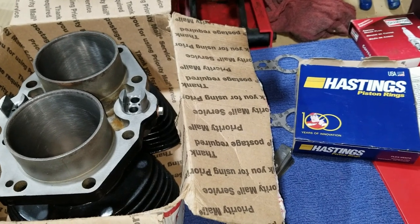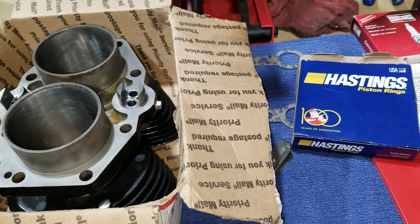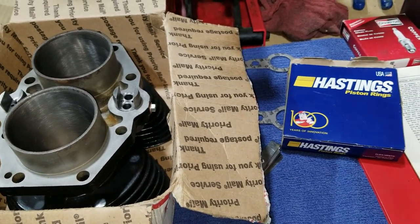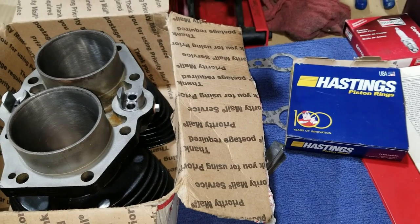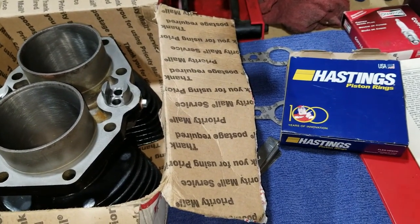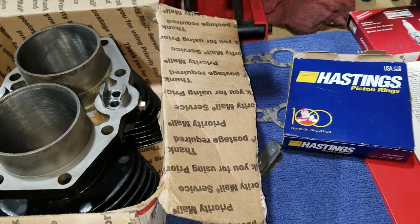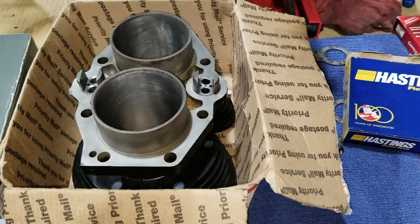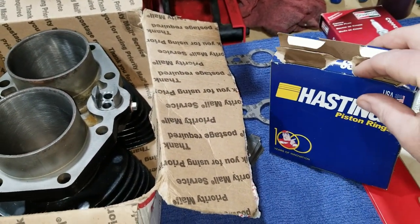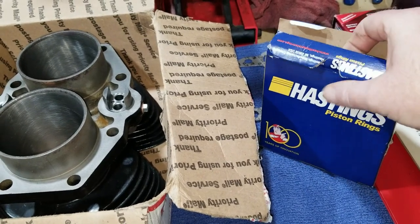These rings have the top chrome ring, like I was saying, which seats slow. They take a little bit longer to break in, is what I mean by seating. That's also kind of good, though. On one side of the argument, the top ring seats kind of slow, but the chrome makes it a harder ring, so in turn they have longer life, apparently, which I think as well.